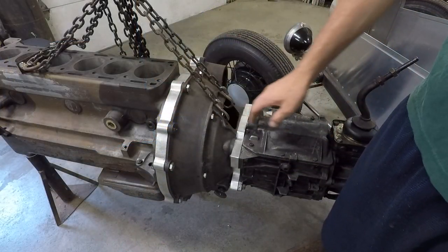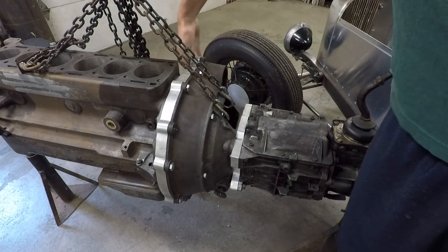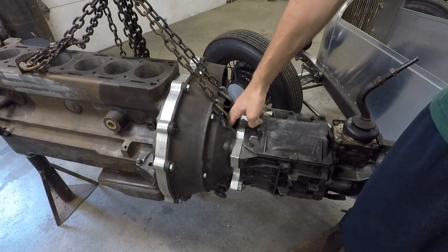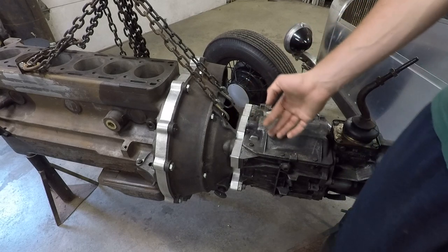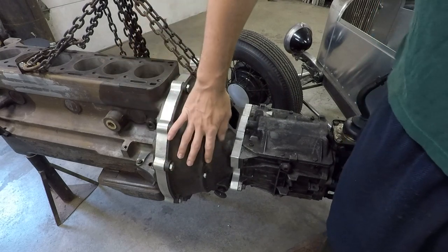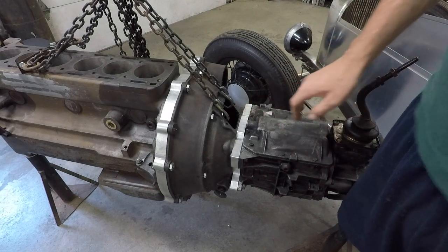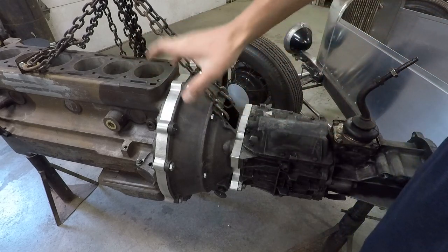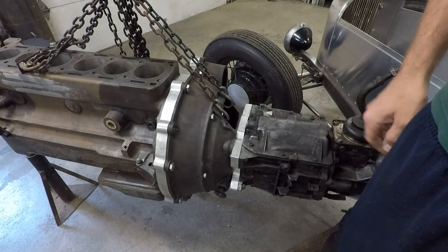That's pretty much the finished drivetrain here now. There's still a couple little things I still have to do from the last video — I still need to mount the starter right up here, and I need to put in a little spring for the throwout bearing, which just keeps tension off of it. But other than that, that's pretty much the drivetrain. I think it's really cool to see the connection of the Jaguar to Ford to Chevy parts and have it all still work out. I hope you guys learned some stuff from this two-part series. Now I can finally start putting the drivetrain into my actual car that I'm building this for. Thanks for watching and I'll see you next time.